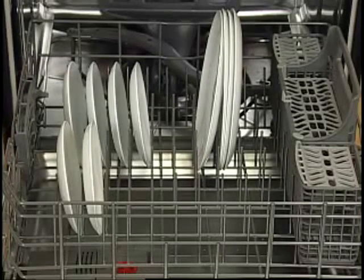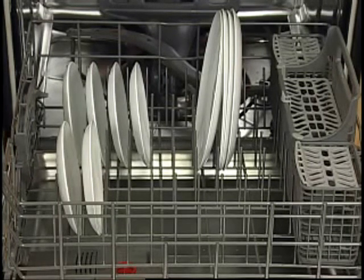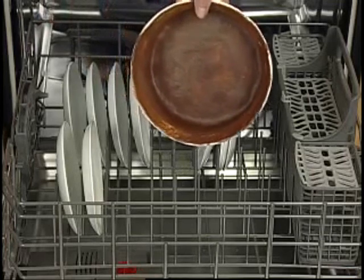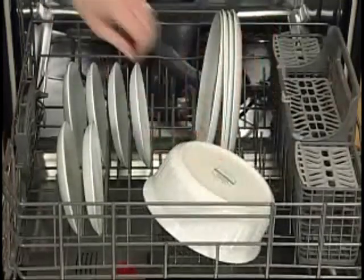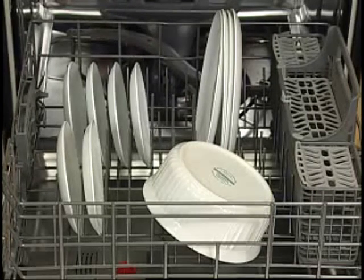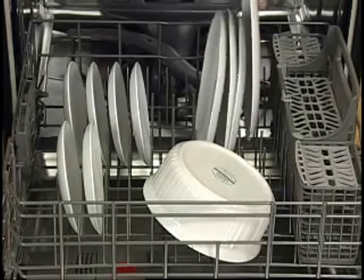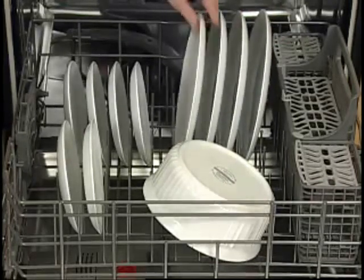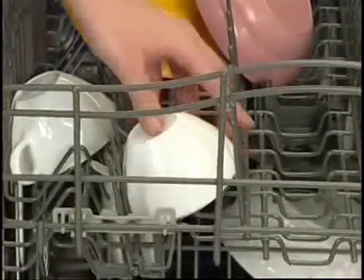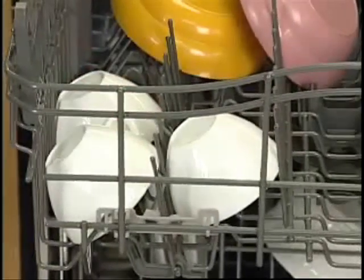For best washing performance, it is important to properly load the dishwasher. Make sure to angle the dirtiest dish surfaces downward and allow space for water to flow up through each rack and between dishware. The dishware should not be so tightly packed where the water cannot reach the dirt on the dishes. Angle concave surfaces, such as the bottom of coffee cups, to allow the water to drain and to improve drying performance.